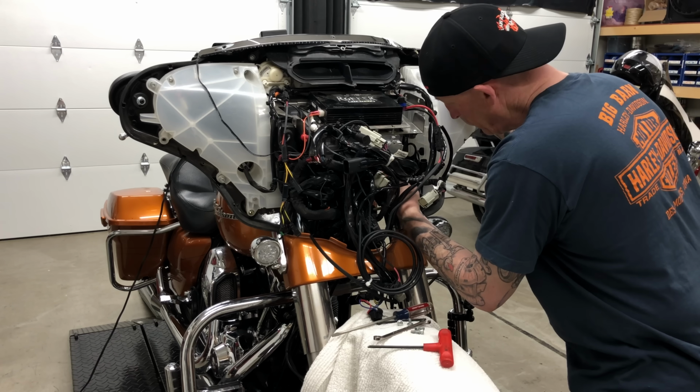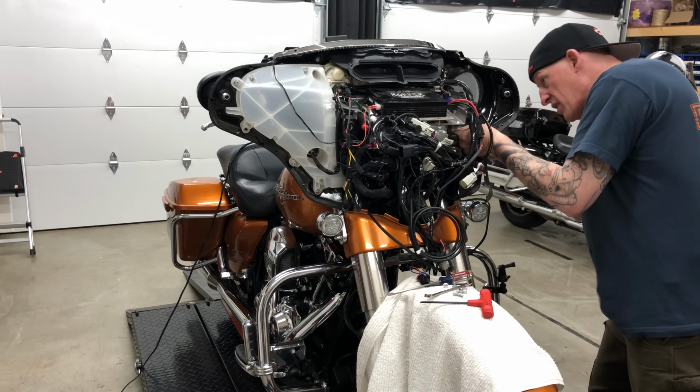That didn't work either. I unpaired everything and paired it again. So then I went in and tore my fairing apart, and I unplugged the WHIM multiple times while the ignition was on to try to reset it. And I went even beyond that and pulled the master fuse in the motorcycle many times just to try to get it to reset, because it was as if it was working somewhat, but it was like a partial software load, for lack of a better term. And as you guessed, none of that worked either. And I had just one more thing to try.